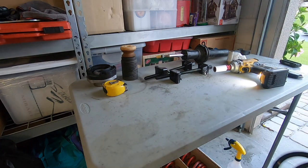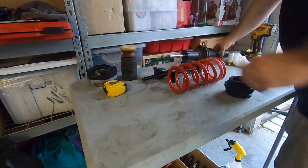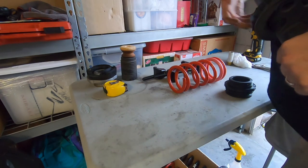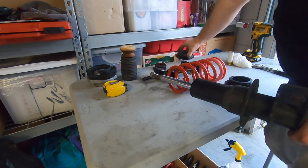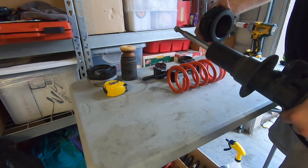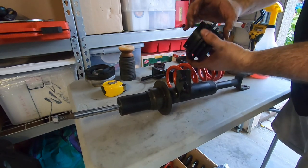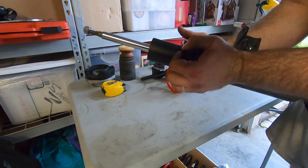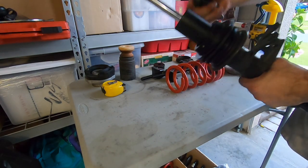When we put this back together we'll use the stock boot and the stock bump stop. This little bottom rubber piece — I was able to pull it off by hand — does not get reused because that is where the new base seats. So I'll go ahead and clean this up, then seat the new piece. There are three little set screws that hold it. After you clean it, seat it all the way down and use a 3mm allen wrench to tighten those set screws evenly.